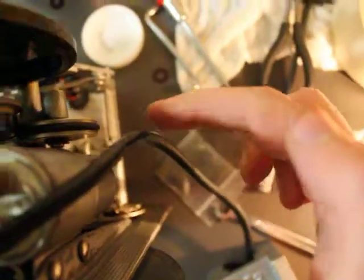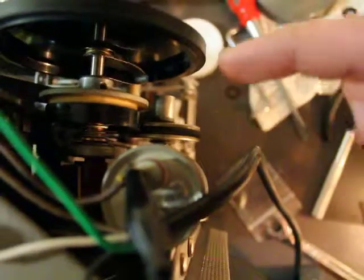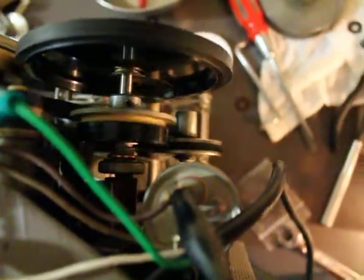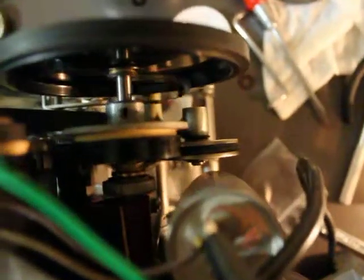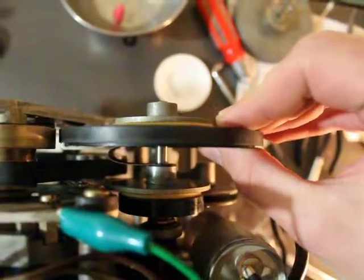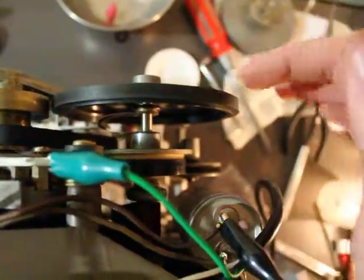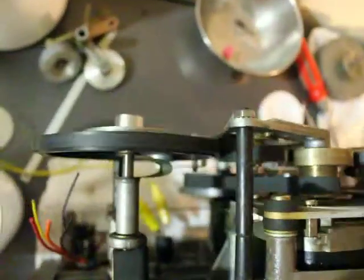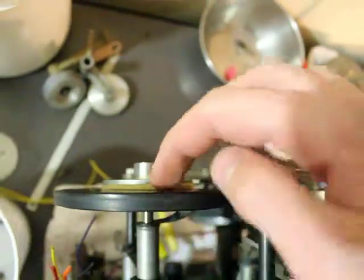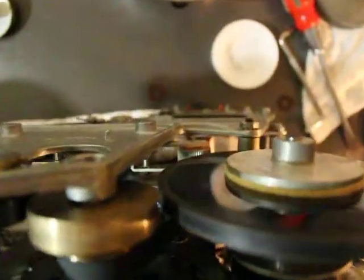What often occurs is the rubber will slip instead of the felt, and the belt will wear down, the plastic will wear down. Obviously it will still work that way, but parts won't last as long as they should. The rattle you hear in fast forward is just this piece wiggling — it's got some shake to it, and the spring could probably bear down on it a little more. In reverse the slipping on this is just loud, but with these mechanical assemblies you can't expect everything to be very quiet.